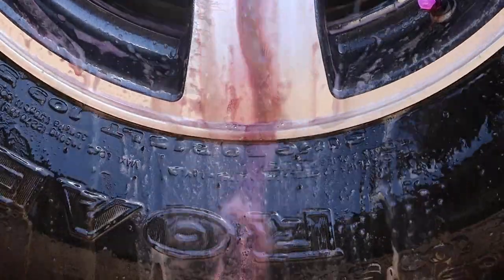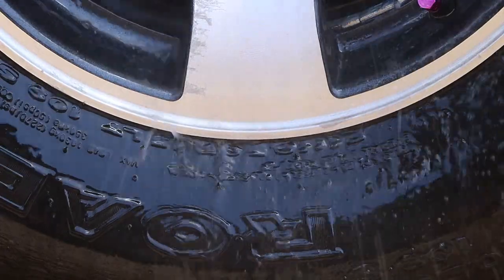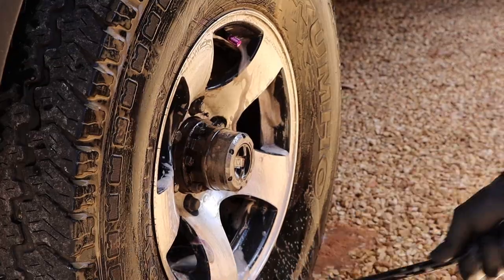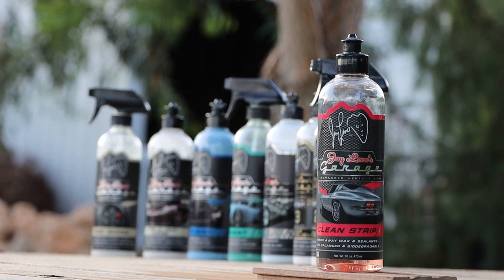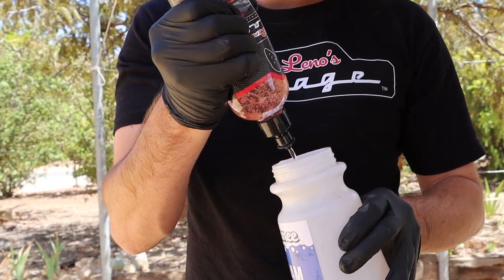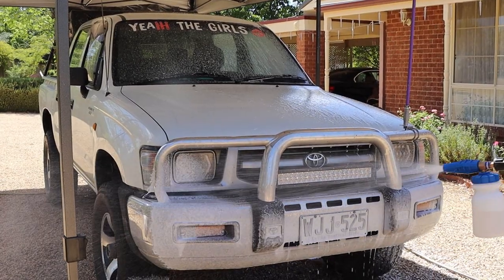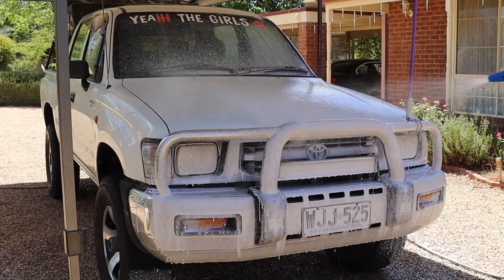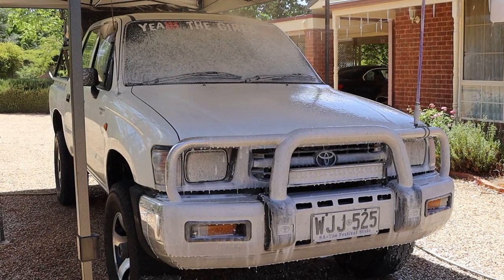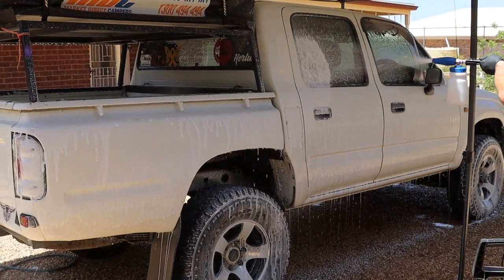This was to be done to all of the wheels as well as using the APC beneath the car too. The second cleaning stage was the first part of the stripping process. We don't want any previous protective layers over the car for what we'll be doing, so bring on the clean strip. I started with the most gentle method and that was through the foam cannon. This will help to remove the loose mess and break down more stuck-on grime without having to lay a hand on the paintwork. I made sure to spray from the bottom to the top, working quickly around the car as it was a warmer day. It's a pH balanced biodegradable detergent that'll be prepping the surface for the next cleaning steps.